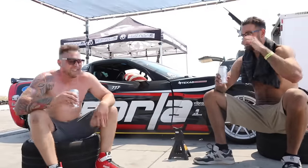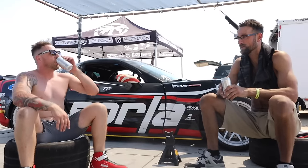That's a cool experience getting to drive something like that. I want to try some insane backies, but I already threw it deep in the tires. Save that for another day. Sick looking entries, though. Your entries are already looking sick, and it's not even half of what you can do in that thing. Let's get the one inch of toe out squared away, then you can start cooking all the way down. I got way more confident in it towards the end on the transitions. At first it felt a little crazy, but it's always like that when you drive a new car the first few laps. Steering's quick, it's darty all over the place. You really have to lean on the front.